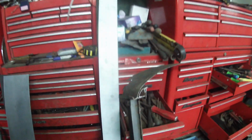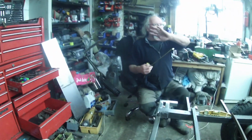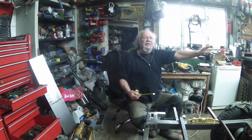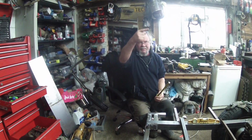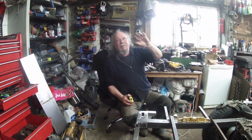And then the roof channels. I did the gutter channels. Look, I chopped the backs of the gutters away. On the back of the roof, the other side, I chopped all that away, ready. And what I'm going to do is, when I've got that roof channel, the guttering channel, in, I'm then going to put a piece of box section along the inside, and I may well get a strip of something like that made, so I can replicate that shape there, and that should give me a bit of roof strength.